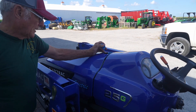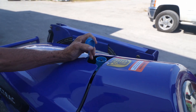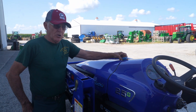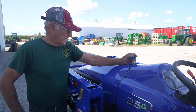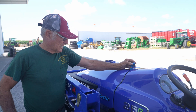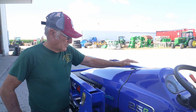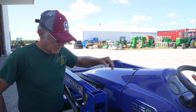There's a charging receptor right here. You can charge with either 110 or 220 volt, but most homeowners and municipalities are just going to use 110, because it will charge on a 15-amp breaker. Think about it — that's low amperage. A 15-amp breaker in eight hours, so the power requirement is not that much. If you need to charge faster, we also offer a 220 charge plug.